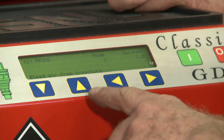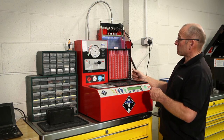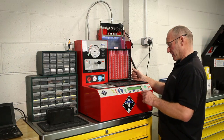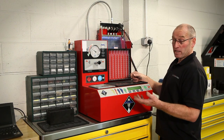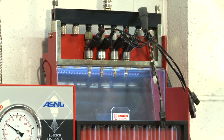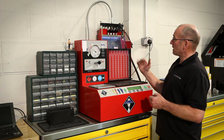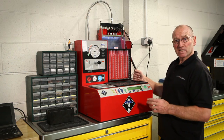And we have a calculator. I think we'll prime them. Machine is on, everything's safe. I'm going to set the pressure — in my case most things we test are at four bar. That's just to prime the injector. Quick look — see if they're leaking, they're not. Into a leak test, which is no drive but run the pump. You can hear the pump running. That's pressurising the injector internally and I'm looking to see if there's any leak. You can leave them to stand — I suggest that you do actually leave them to stand. For this purpose of demonstration, we'll assume that is a satisfactory leak test.